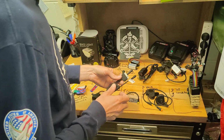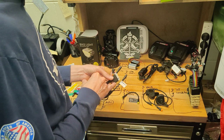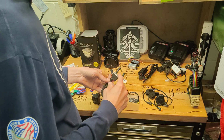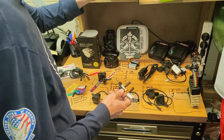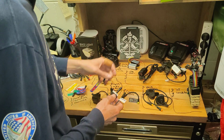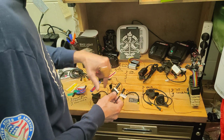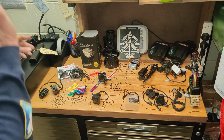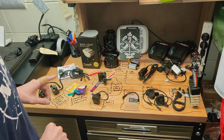then this relay activates, the power flows through it, and it switches the contacts over to disable the power through there. And there's also a flyback protection diode in there as well, because when you're switching relays on and off, you can damage your switching circuits, which is in the display, power on, power off, or the NFC, with flyback. So that's just flyback protection. So I think that's about it. I think I've covered everything.